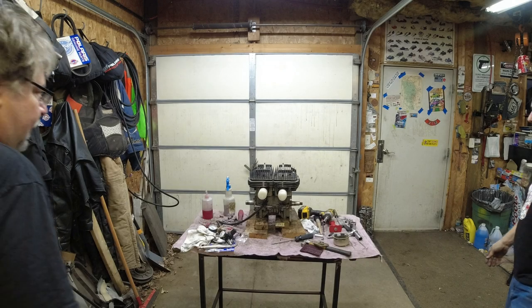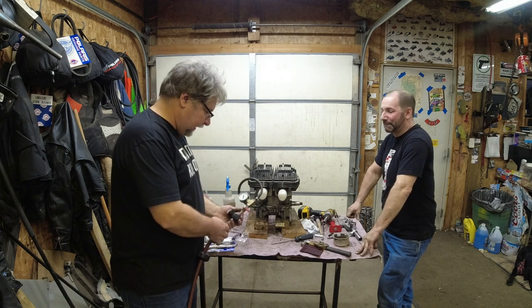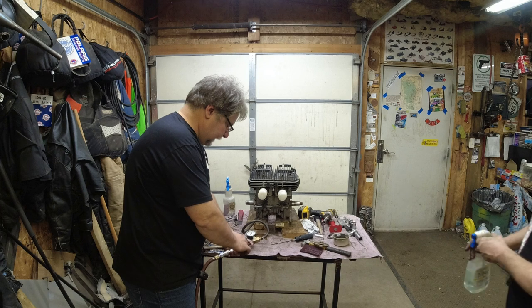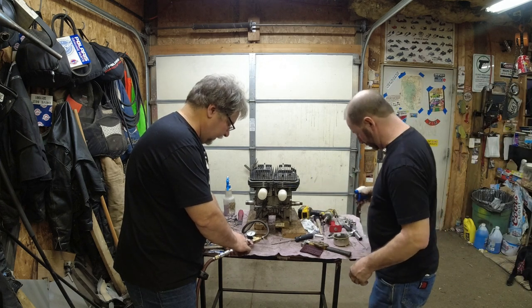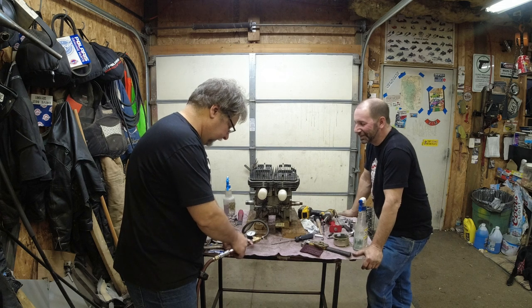All right, bringing you back. We've been building the motor. Pressure check time. Only 7 PSI, like I mentioned earlier, because this has got the old school seals on it, especially that seal on the mag side. You don't even have to squirt yet. Let's save the squirt bottle till we know we have a leak. Assume the best.